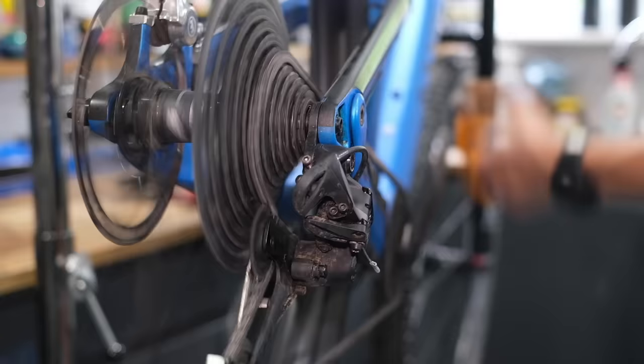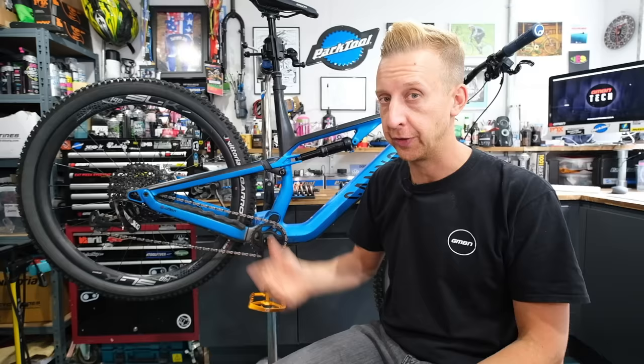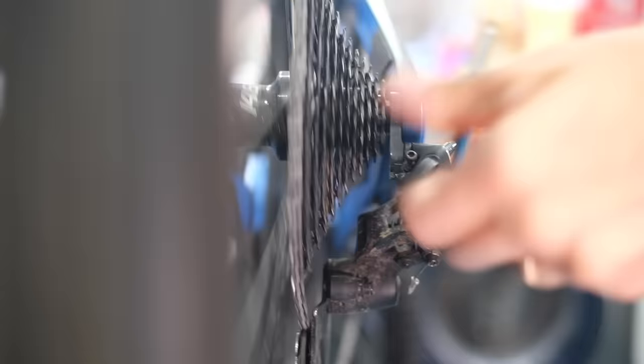Get the bike up into that gear — take caution in case it overshifts. Using your line of sight, this is where it's really quite difficult if you have a big tire, especially because you're so far inboard of the wheel, almost directly in line with the rim. If you're struggling here, you will need to remove the tire. Continue making adjustments to that limit screw until the upper jockey wheel is sat directly underneath, completely in line with that biggest sprocket on your rear cassette.